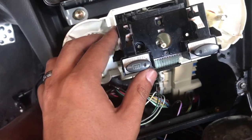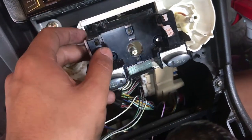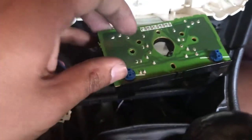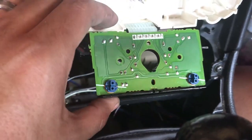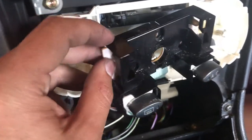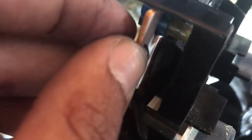To change the lights from the center console, there's two screws — one right here, one right there, Phillips. In the back you'll see it has two little light bulbs, you just got to replace those or put something different: purple, blue, green. The old two thousands are green.